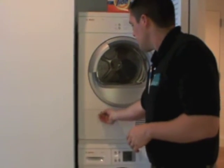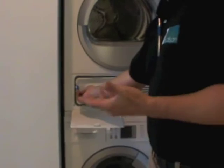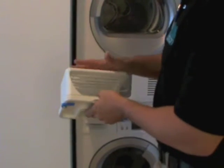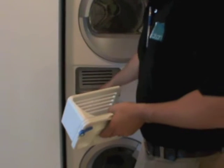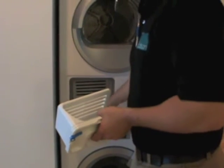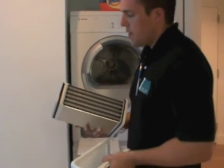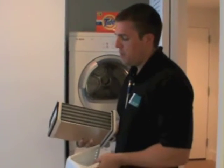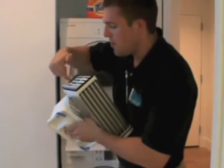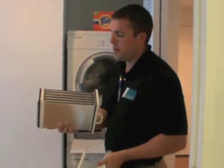To clean your filter, you're going to open it by pushing down on this tab — this door opens. Then move the blue tabs, unlocking them, and you'll be able to pull out this little stopper here. When you pull out this stopper, you might get a little bit of water that comes out, so get a paper towel or a rag just to clean up some of the water. The filter that you're actually going to clean is this right here. All you're going to do is take this filter into the bathtub and run water down through all these slots and holes, washing out very fine lint that gets trapped in the filter.